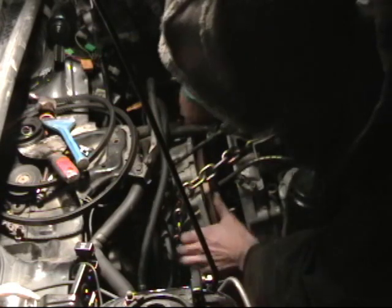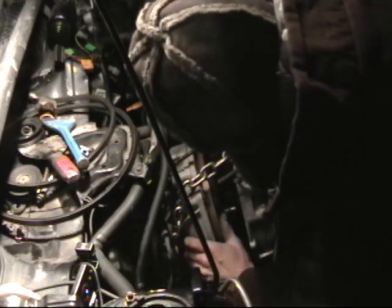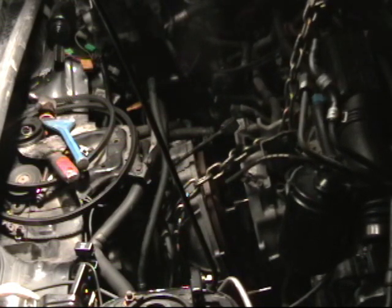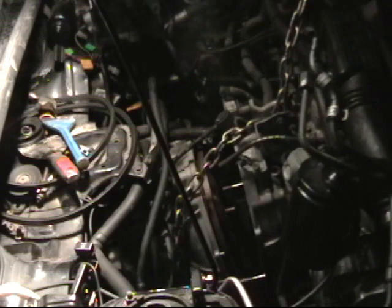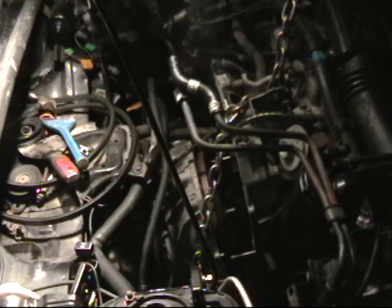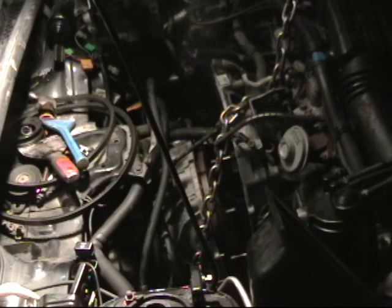All right, the studs are free from the bell housing. The torque converter should be flush with the inside of the transmission bell housing. Sometimes it's a pain to get in there, which I'm probably not going to be able to get it from this direction. So I'll work the motor, you work the crane. If you pump it up for me, I'll just hold it out of the way till it clears. Hold on 1 second. Swing the air box out of the way. All right, continue.